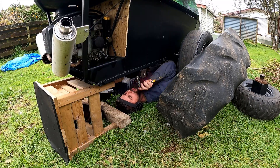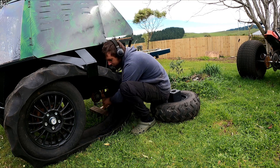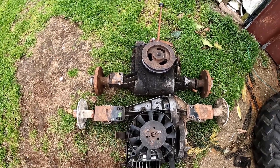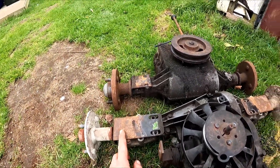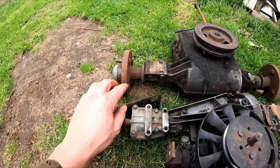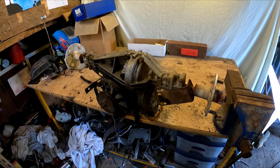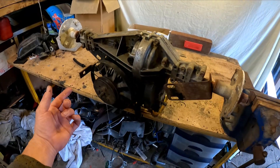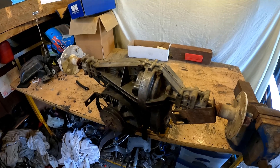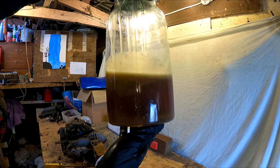If not, I'll just fix that gearbox. So the diff is out - they're side by side. First difference is this one is about 60mm wider. I could either trim those down or move it to the other side, which is going to be better because then it's got less leverage on the axle to break it. Draining the oil out - usually my method is I just take it apart and let the oil go everywhere, but I'm figuring it out properly this time. The guy at the mower shop said when it was going up a hill it was slipping, which is a common problem. There's a detailed video on YouTube - I'll put a link to it if I can find it. The oil is pretty much brand new, good to go back in.